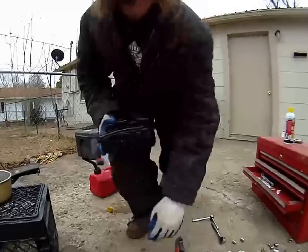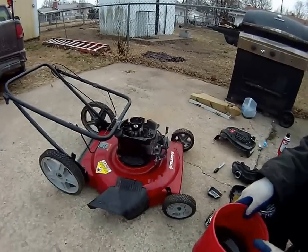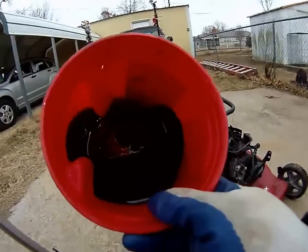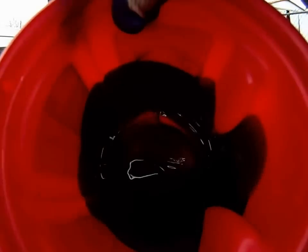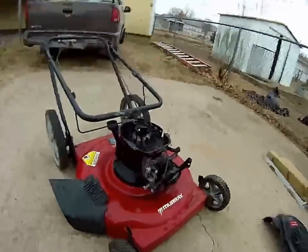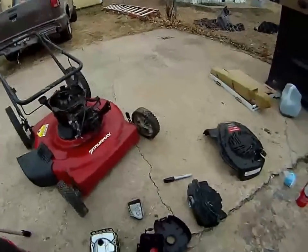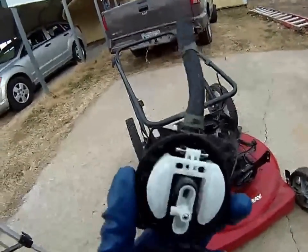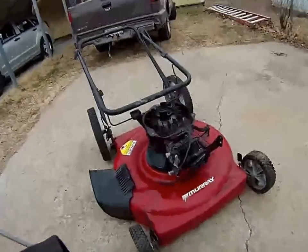Left that thing inside to warm up and thaw out for a couple of hours. Got all the oil drained out — it's looking pretty black, and it does look like there's some water in there too. Now I'm gonna put it all back together; got everything cleaned out. I'm gonna spray this carb out — it's all dry now, there's no more ice. I'm gonna spray this out with carb cleaner and spray this tube out and things like that, then start putting it back together.